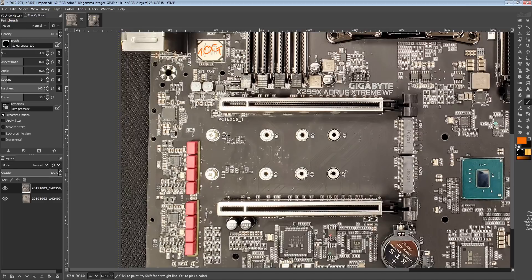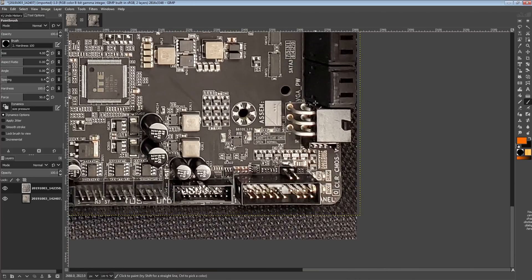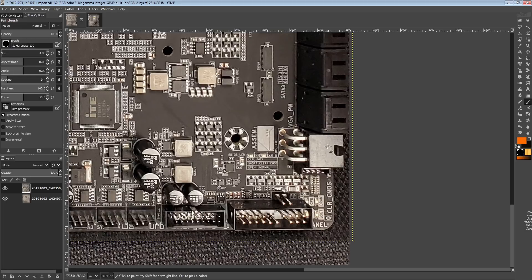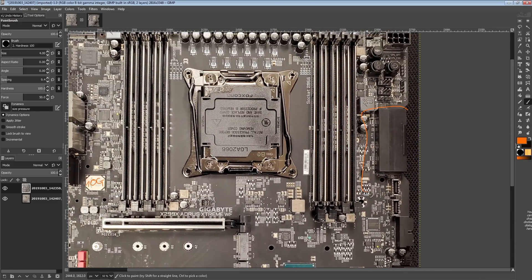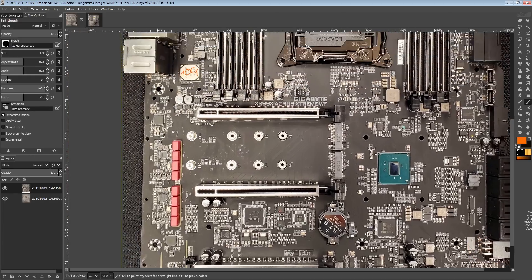The PCIe slots probably wouldn't power on — if you feed a GPU with 12 volts but don't give it 3.3 volts, it's not going to turn on, because 3.3 volts is used for enable. Up next we have this right here, which is an extra 6-pin power connector. If you're running a 3-way GPU setup, you might actually run pretty close to the limits of what the 24-pin can provide in terms of 12-volt power, and this extra 6-pin takes care of that. It's also in a very reasonable location — this is where extra PCIe slot power should be.